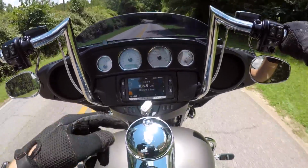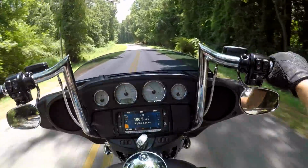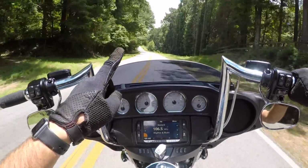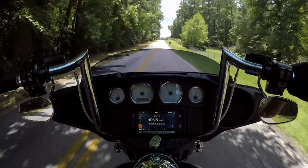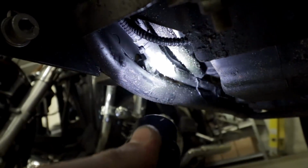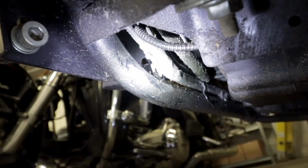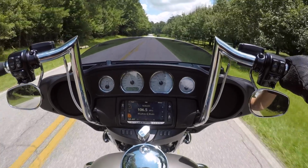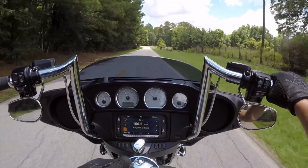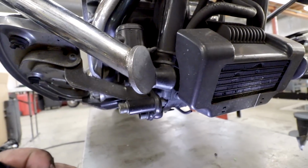Simple things like this footrest right here on the right side, I just took it off of this bike to pull the exhaust off to run a new hydraulic clutch line. But '06 and earlier right side footrests were an absolute pain to get off. The bolt placement and the size of the bolt were a pain. It's a 3/8 Allen from the inside, threads into the footboard bracket. It sucks. That's up to '08 that they do it like that. The frame change in '09 brought forth bolts that come from the outside in, but the front one has a nut on it.